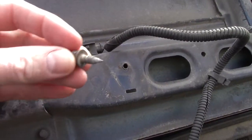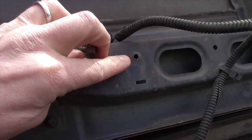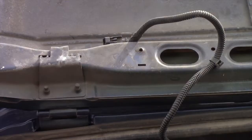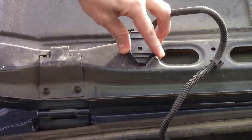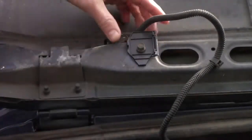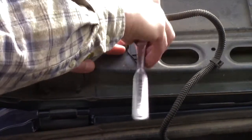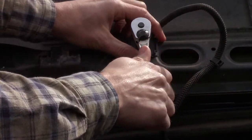You can see I've already removed the old mounting plate — that's just this one little screw here, goes right there, and this is a 10mm in case you're wondering. The new plate slips in place just like this. The little tab goes in that hole, screw goes in this hole. Tighten it up with a 10mm socket and cinch it up. There we go.